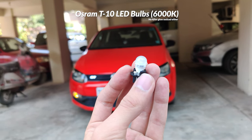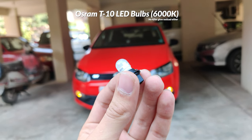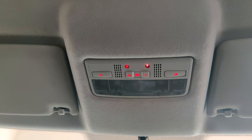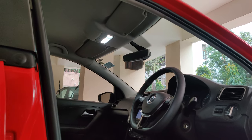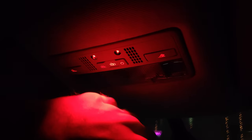I also switched the halogen bulbs to LED bulbs, which are linked in the description. With LED bulbs, you will need to be careful of polarity — otherwise you will end up with something like this — but with polarity sorted out, this is how the light looked finally. LED bulbs give a good dimming effect as well, not as smooth as halogen obviously, but still good considering they're LED. This is how the ambient light falls on the DSG gear selector and the rest of the interior. It looks slightly brighter on camera but in reality it's not really noticeable, as it should be, being an ambient light. It adds to the premiumness of the cabin and blends in with the rest of the backlit buttons.